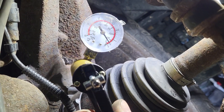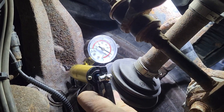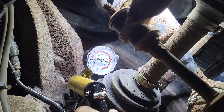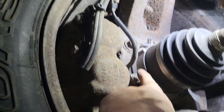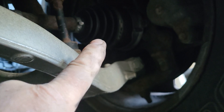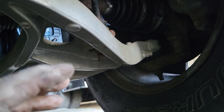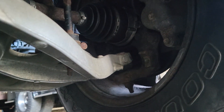Now we're connected on the other side - we're up to about 12 inches of vacuum and it's holding. It's leaking down a little because this is a cheap vacuum pump, but we know this one is holding vacuum and that other one is not. That's the one making noise - it's trying to disengage and causing the gears inside to grind. We're going to put a new one on.